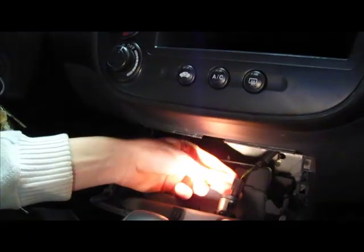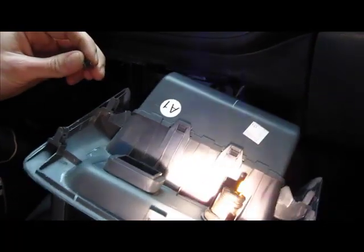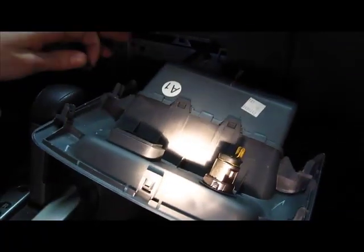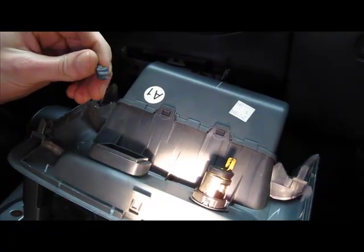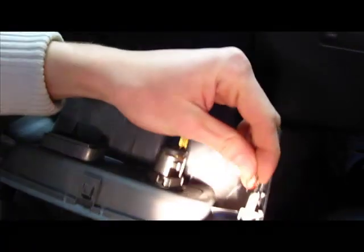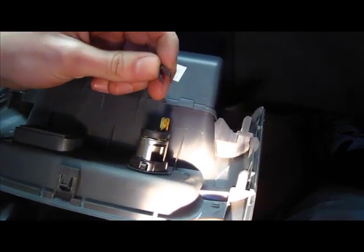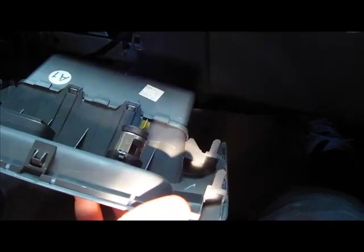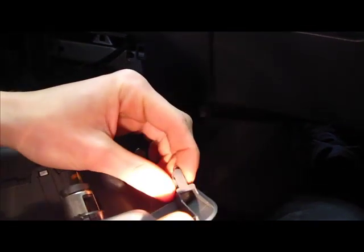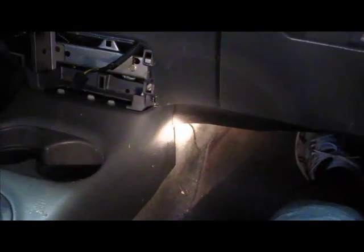Once you take that off, you have to disconnect this plug. So once you take the cigarette lighter plug off, you might find that there are four clips holding this panel into the dashboard. You might hear a little metal noise and some clips flying off — you have to find all of them. When you take it off, you've got to put them back onto the panel, so next time you put it in it will clip in and hold the panel in. If you don't put these clips back on, it's just going to rattle or come off by itself.